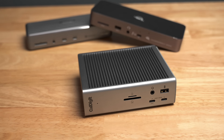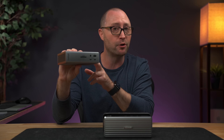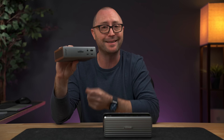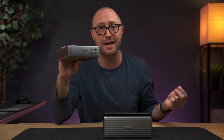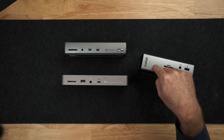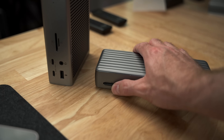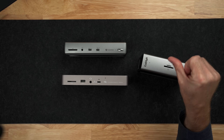The TS4 has two SD card slots and the OWC and the Anker have one each. The CalDigit can use either SD or microSD cards in two separate slots simultaneously — so you can pull video data off a camera and audio data off an audio recorder at the same time. The TS4 and the Anker have a spring-loaded SD card slot, whereas the OWC does not. I much prefer the springy action because you can push the card in and know it's connected. I tested SD card speed on all three devices and they all came out about the same — around 100 megabytes per second write and 260 megabytes per second read.